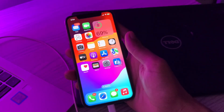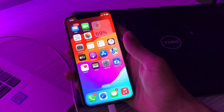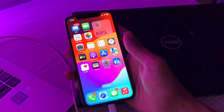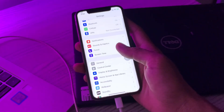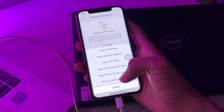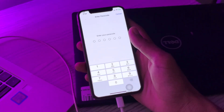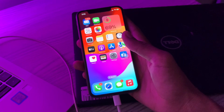The last step is to reset network settings. Your network settings can interfere with AirPrint technology because iOS does not tolerate incorrect configuration and security protocols. You can reset the network settings on your iOS device and then try to connect with the printer. Go to Settings, click on General, scroll down, click on Transfer or Reset iPhone, click on Reset, then click on Reset Network Settings. You won't lose any of your data. Enter your iPhone password to confirm the reset.